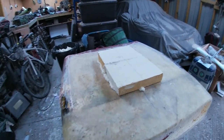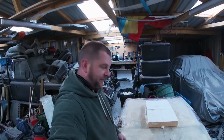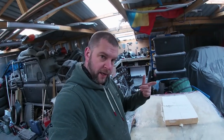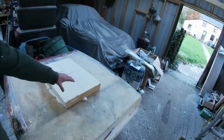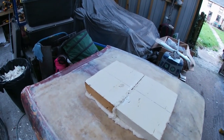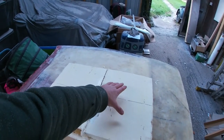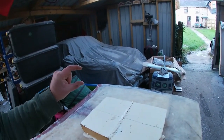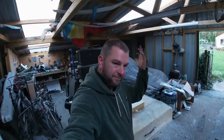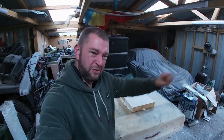And as I said before, the idea is to have the hood scoop functional. So what I mean by that is it will have a small mesh grill in the front. It'll be a hollow chamber going back through the bonnet. And then on the underside of the bonnet, I'm going to sculpt another fiberglass piece, which will essentially be a tunnel that mirrors this one on top and then swings around to this side, because obviously in my car, this is where the carbs are. I think they're this side. Maybe the other side, can't remember. One of the sides, I'll have a look. And then that can come across and then turn 90 degrees. It won't be like a big deep thing, it'll just be a nice flat tube that goes through, so you have some fresh air for the engine, which they like, rather than that horrible looking cassette thing they used to have with the two hoses going towards the front.